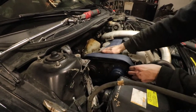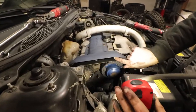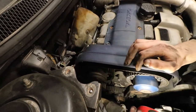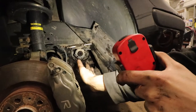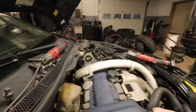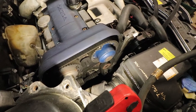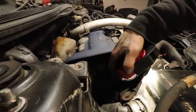Put the clip in place and that will give us our timing marks. You can see somebody has actually marked it with white paint, and there's a dot. After taking the balancer off, put the nut gently back on — seated all the way but not tight — so you can spin it over. Now spin it clockwise; you never want to go counter-clockwise as you can slip the belt because it's not designed to go that way.